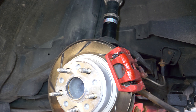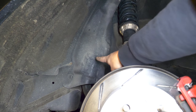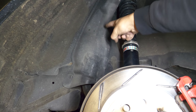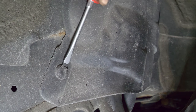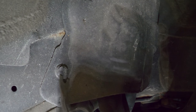Step one is going to be removing every part that you can so that you can clean up the body and make it look nice. On the rear suspension of this car we've got this plastic piece that we're going to remove because there's still metal found underneath it. This is actually leading from the gas cap and going all the way down into the fuel tank. So we're going to take this off and paint up the metal that's found behind this plastic cover. To remove this little panel I'm going to be using a panel popper and a flathead screwdriver just to push out the center part of each one of these push pins, and then once you have the center out you can push out the outer part.